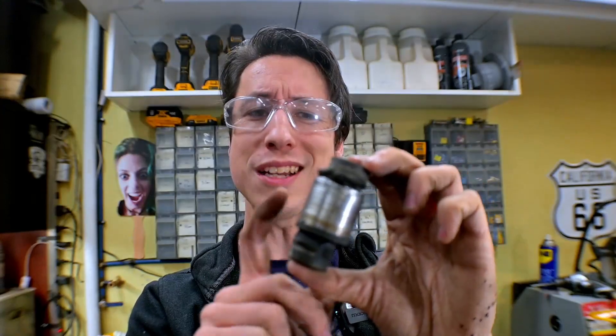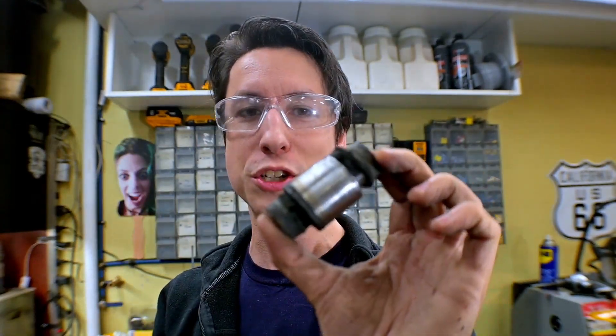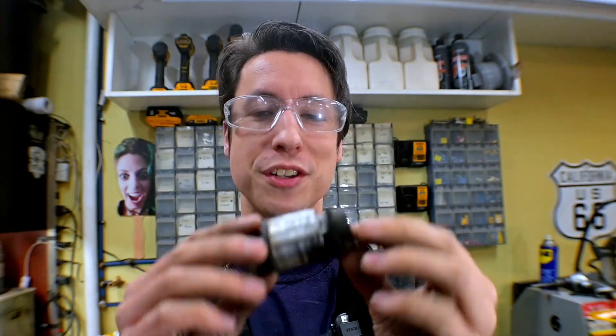For those of you that stuck around to the end — let me show you why I don't use drill bits anymore. This is the piece I just removed from the inside of one of the bushings and it looks like just a big chunk of rubber, like you probably expected. Here's the reality though: there's actually another metal sleeve that sits in between the two layers, and that thing loves to catch drill bits — that's why you break them off all the time. Have a good one, we'll see you next time.